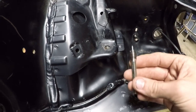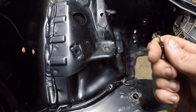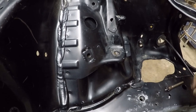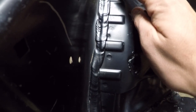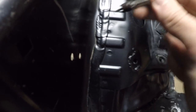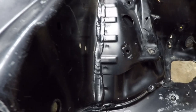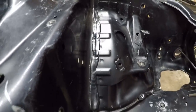What we're going to use is this nifty little guy right here — it's a spot weld removal tool. They're dirt cheap; you can get them at Harbor Freight. They're two-sided, you can flip it around and reuse it. If you've never used one of these before — we've got all these spot welds — what you want to do is get in the middle of them and drill a little pilot hole, just to keep the punch centered. Then you go right into the middle of it with your drill and spin and it'll eat everything out. We're also going to get rid of all the body caulk in here and the whole engine bay.